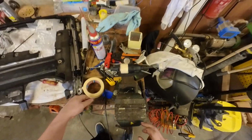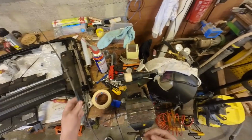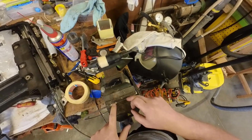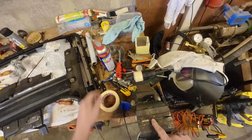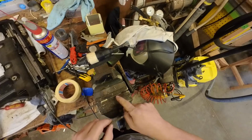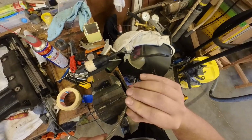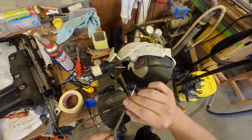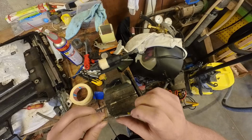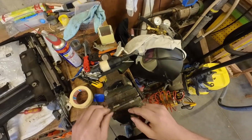So as you saw, we cut off the excess part here for the Mercedes sunroof carriage. And now the most tedious part is to unwind the outer skin of the wire. So it has to look like this. This was my test piece. You have this thicker wire, which is used as a thread for the gears to engage. And then underneath that is another layer of steel wire. So it basically has this thick one and then a thinner wire underneath. But we also have to remove that one until we get to this part. So it's a tedious part.